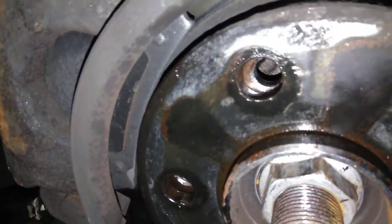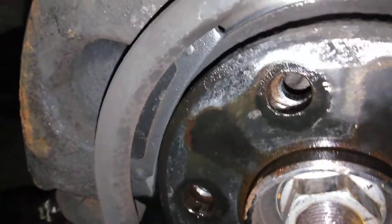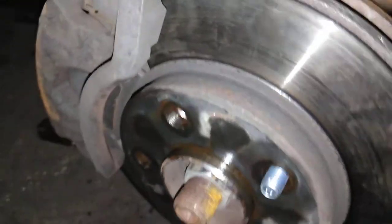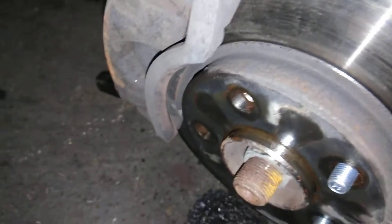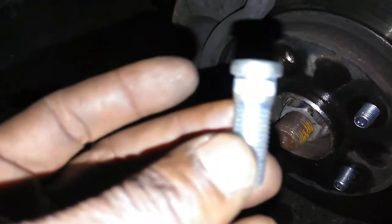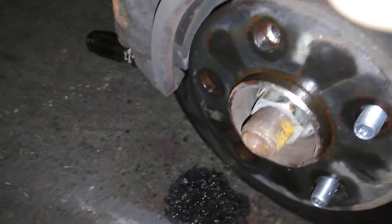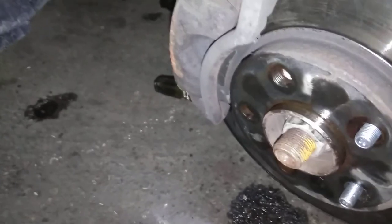Let's see what we got here. And you like that. Now, you also got to make sure those little grooves here on the stud, which is also connected to the hub, match, you know, that they go in there. They're snug. Now, as far as lug nuts, when I change studs, I always change the lug nuts. So guys, always change your lug nuts, all right?